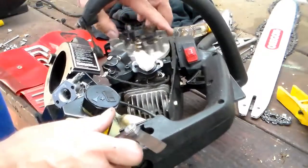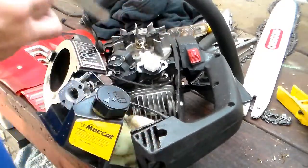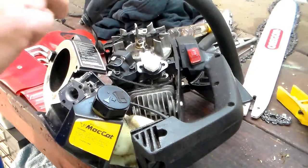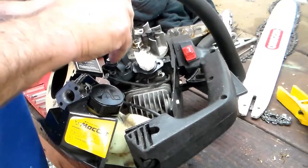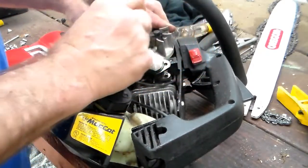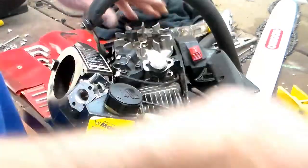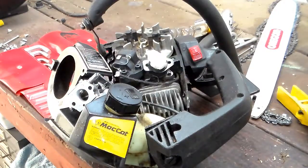I started with 16 thousandths — we'll spin it around again to the magnet. One other thing I want to add: I recommend you take the spark plug out when you do this to make it a little easier to spin. Ten thousandths is tight but it fits on this side, but still doesn't fit on the other side. It's kind of like one of those back-and-forth things, so I'm going to pause it until I get it and then we'll come back.